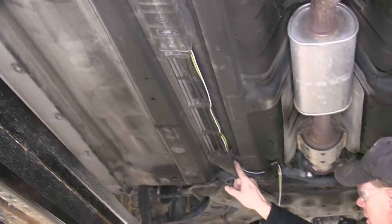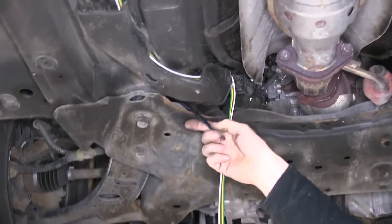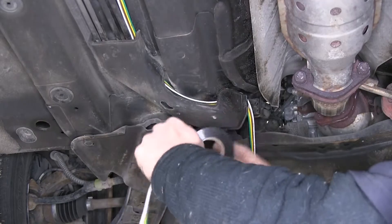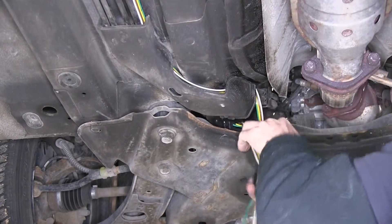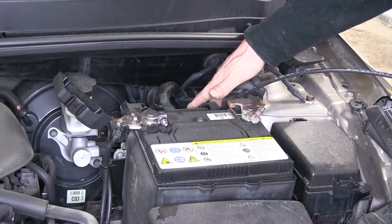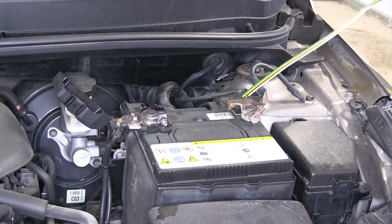Go back into another plastic guard and work the wire up to the front suspension area. Use a piece of old airline tubing to help pull the wire up from the top to the bottom — attach it with electric tape to the four pole wire harness and pull it up to the top. This pull wire can be any piece of wire that holds its shape as you run it down through. Tuck it up in there and pull it out from the top. The pull wire route goes behind the battery and alongside the side of the firewall, running down between the brake lines to keep it away from any steering components. Pull up the wire and take up all the slack.